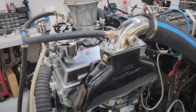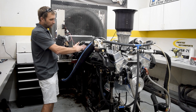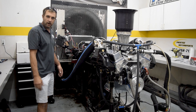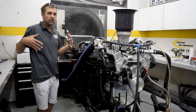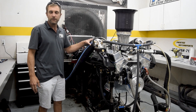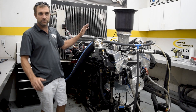This is a short tailpipe — actually a tailpipe for a captain's choice exhaust. Basically, there's a T put in with a flapper valve. What it allows you to do is send the exhaust straight out the transom and make it sound mean, or the flap will close it off and a pipe goes down and out the bottom of the transom, through the drive unit. All of the exhaust is underneath the water — a little quieter cruising around. Leaving the marina, a guy wants to turn captain's choice on, it's out the back of the transom sounding nasty.